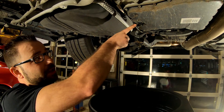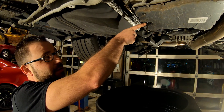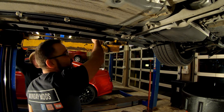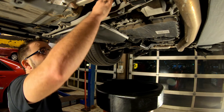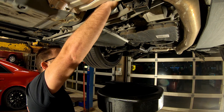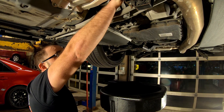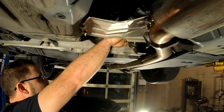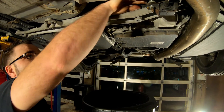There's actually another tube inside of here, so while that drains, we're also going to remove the fill plug and we'll move on and break open the rear differential. Removing the fill plug will also release pressure and may help it drain more fully.